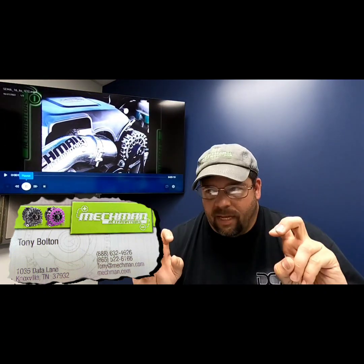So that's where you'll get your 16 volt and then 14 volt, 16 and 15 and all over the place. Normal fluctuating is okay. 14.4, 14.6, 7, 8. It's perfectly fine. It's no big deal. A lot of you guys want set voltage, I need it set at 14.6 volts. If it does 14.5 volts or 14.7 volts, your car's not going to blow up. Your battery's not going to blow up.